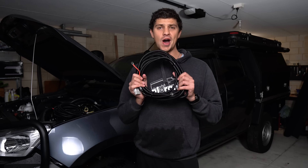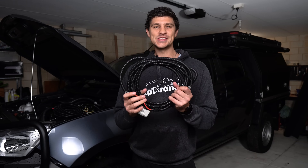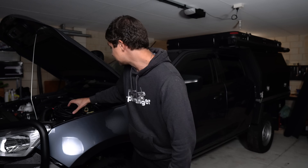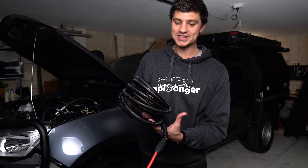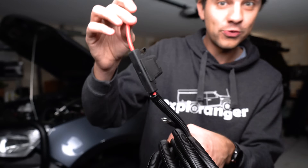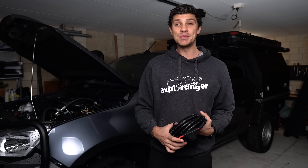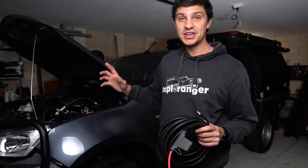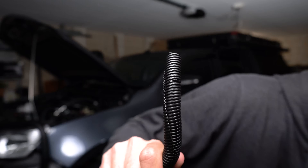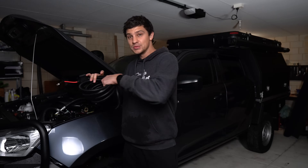I've started this 12-volt install by removing pieces instead of adding them. I pulled out the factory wiring for the central locking system in the canopy, to make way for my own version using the thick 100 amp cable. That's more than enough to power the 40 amp DC-DC charger, and it means there's only one cable to disconnect when I remove the canopy. The next step is connecting this to the main battery, running it all the way back to the canopy as neatly as possible, then wiring an Anderson plug on the end.